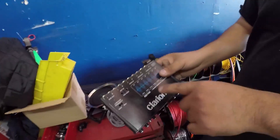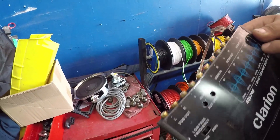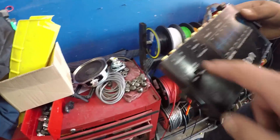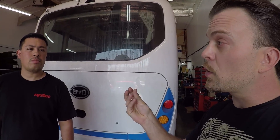I didn't want my signal to be like this. This was not a setting point for me — you turn it up to here. But I want to keep it on stock speakers. Yeah, that'll be easy because you just have to find the crossover points for each speaker. What you can do is play pink noise out of the speaker and measure it with RTA and see where it naturally rolls off.